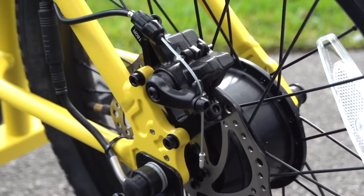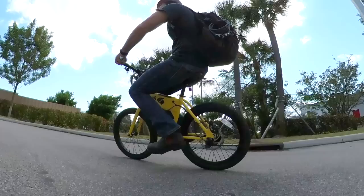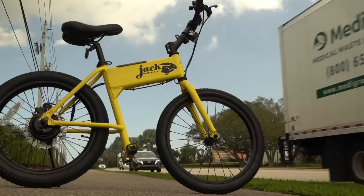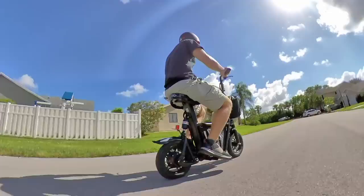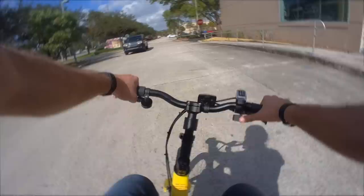There's only one disc brake and it's on the rear wheel, but that feels like a prudent design choice. You're basically sitting on the rear wheel, so you've got plenty of traction, meaning that brake has a lot of stopping power. And you don't have the danger of going over the handlebars from a powerful front brake. On short wheelbase vehicles with so much weight high above the front axle, tipping can be a problem with front brakes. So I get the single brake decision, and it still brings you to a stop quickly and safely.